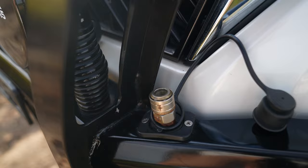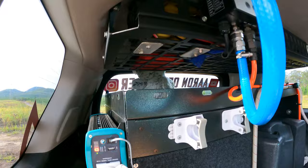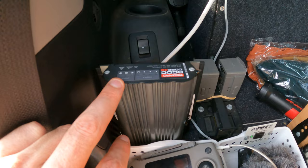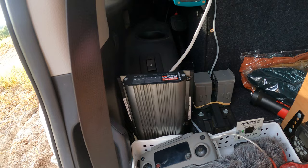I'm not sure I've really shown the inflation setup in detail before, but all you do is turn it on and it's like a service station — you can set your pressure. I've got a 1,000-watt inverter up in here with a remote switch. There's a bit of a junk section here which is quite messy at the moment. Got a Redarc 40-amp DC-DC charger — their new model, 40 amps, lithium compatible. It's made for internal use only, can't put it under the bonnet, which I didn't want anyway — works really well, saved a bit of money.